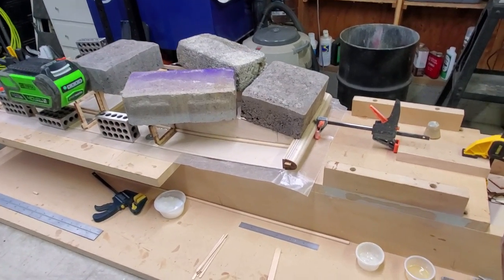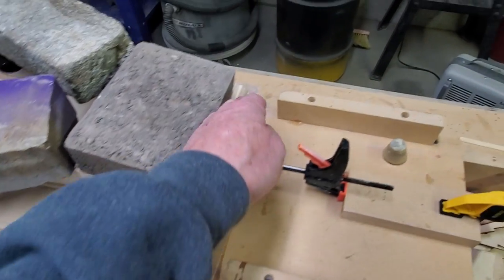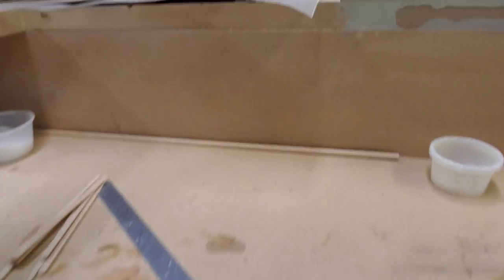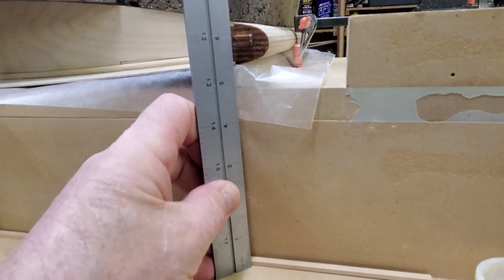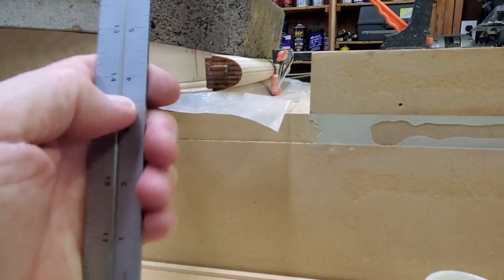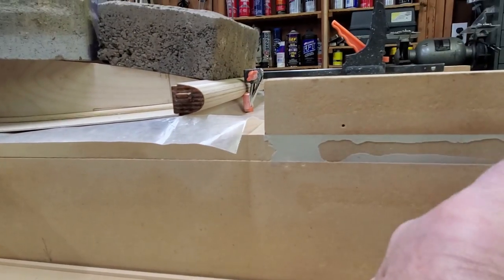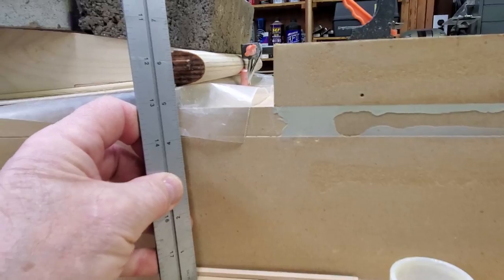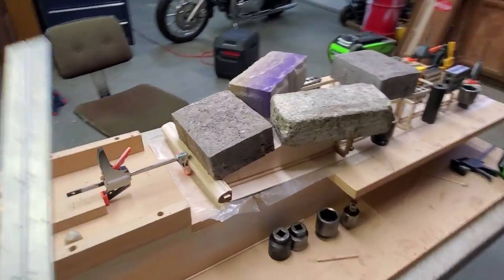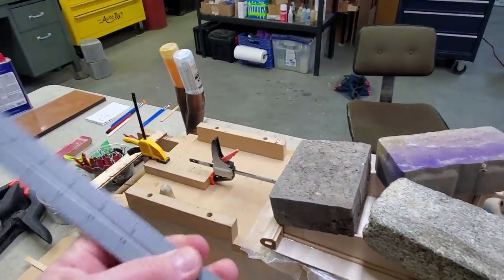All right, if you've done it right, your setup should look something like this. A little pressure here, a good deal of weight here — I've pushed and wiggled and made sure that it's correct. Now's the time you want to check each side. Five and three-quarter inches at the back corner of my slot — I verified this number. Do that before you disassemble your mock-up: find out exactly where this height is with your mock-up setup and your sponson tips at the right height. Check this spot right here — five and three-quarter. Sorry, that's tough with the phone, but the GoPro thing isn't working out so well.